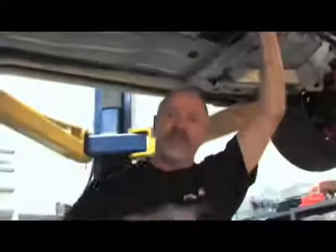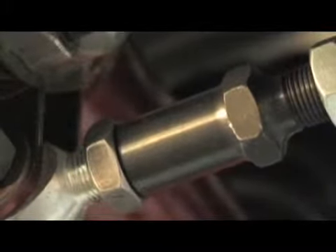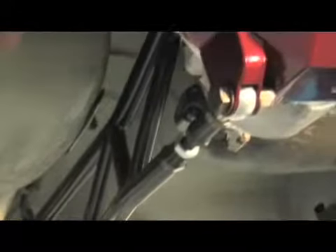BJ jacked up the M9 into position under the car and bolted in the control arms and the panhard bar. Everything fit fine, and then it was time to move on to the torque arm. This is really cool — Moser added a sliding front mount to their torque arm. This slip joint actually moves in and out as the torque arm moves up and down with the rear suspension, preventing any kind of bind. And at the rear end where the torque arm mounts to the actual M9 itself, there is an adjustment buckle. You can turn it in or out, which will bring the pinion angle down or up six degrees and keep good alignment with the rest of your drivetrain.